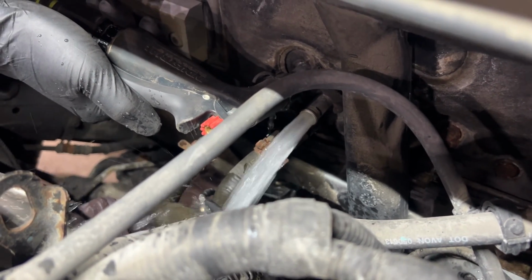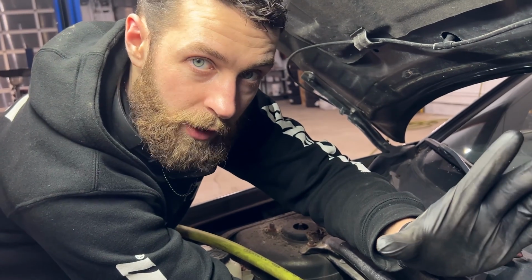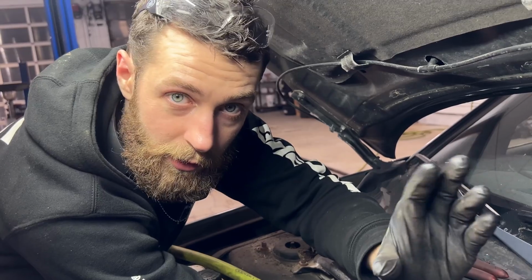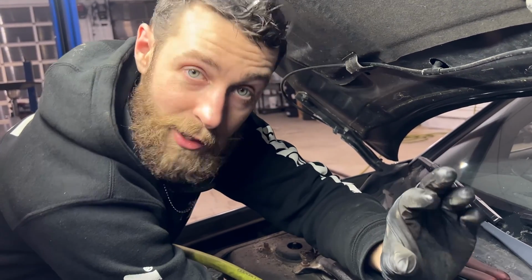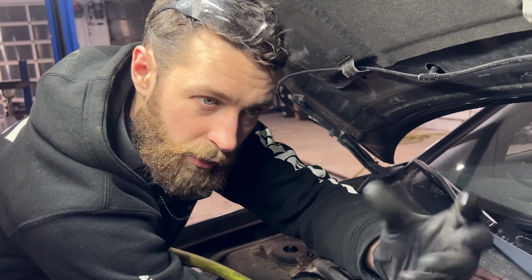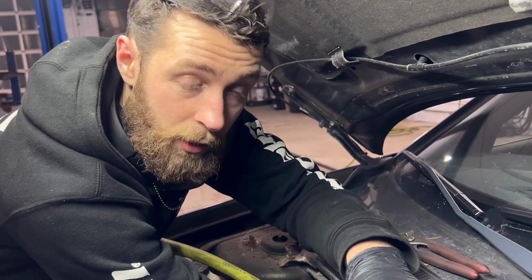The one that I used to use did that. Plus there was an air line fitting that you could put your air hose on, and it would aerate. You could adjust how much aeration the water had, so it would really disturb all the stuff that was inside the heater core, and it works very well.